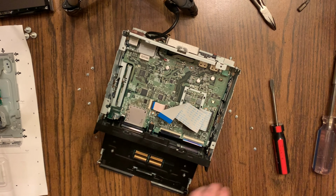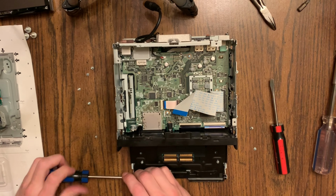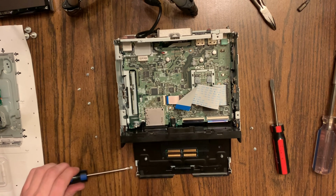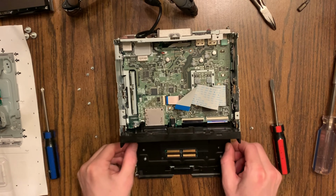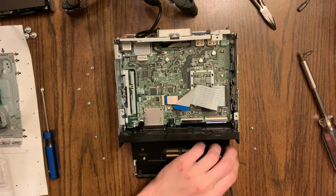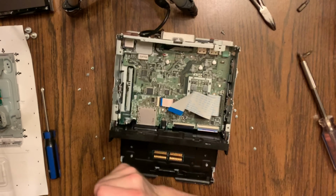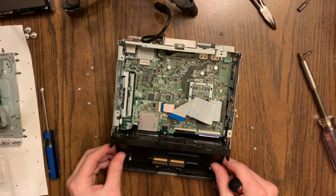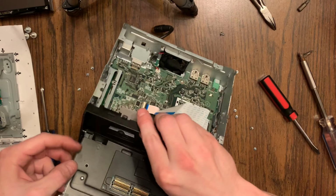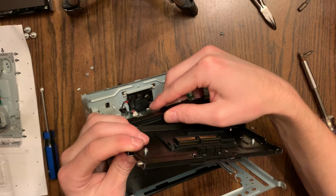And there's 2 screws at the hinge points on it down below that hold the thing to the metal frame, I guess you'd say, to the slider. Take both of those screws out, then kind of pry those metal arms off to the side, and then the black part will come free. So there's the right side, there's the left side, that's out, and now it swivels up and down. So just swivel one side higher than the other, like that, and it'll come right out.